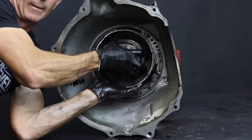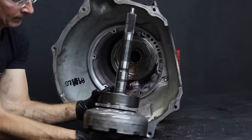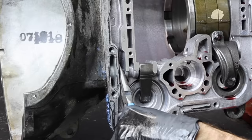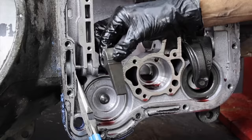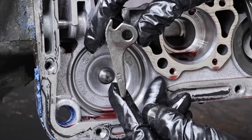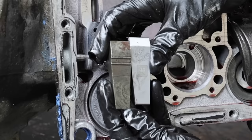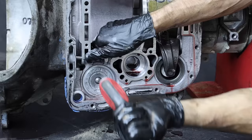Let's remove the planetary assembly. Let's also remove the second gear lever — I'll remove the plug which locks the lever pin into position, and use needle nose pliers to slide the pin towards the front. The second gear lever is out. It's a 3.8 ratio made of cast iron and is being replaced by a 4.2 ratio lever made of billet, giving a mechanical advantage over the original and made of much stronger material.